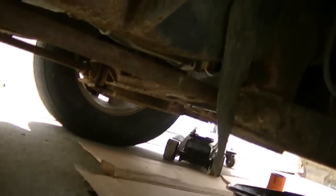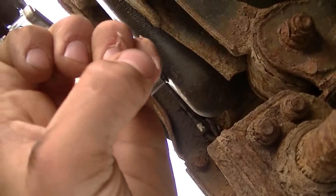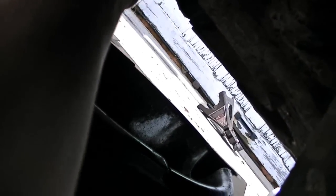So now we can come under here and do our oil pan plug. With a 14 millimeter socket wrench, I'm just going to put it right on this plug down here from the oil pan. That took off some skin — that hurts a lot. I'm going to take that second wrench right off. Get your pan into place and there you go — let the oil flow.